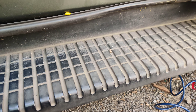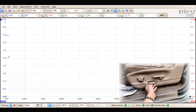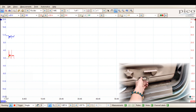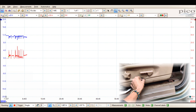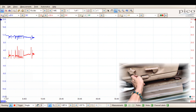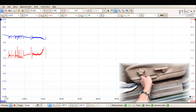We're gonna get back — got the Pico set up, so I'm gonna switch over and we're gonna screen record. So we got the Pico set up now. I'm gonna move the seat and you'll see what happens. We go back, forward — the front goes up and down, the rear ain't moving. Let's go front. There we go, we can see our current pull. Let's go back and see what happens.